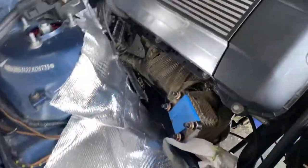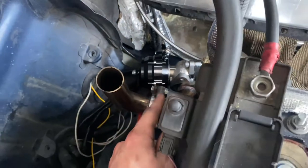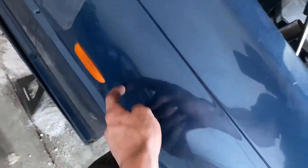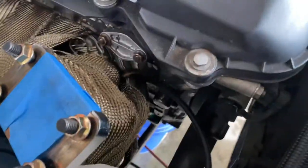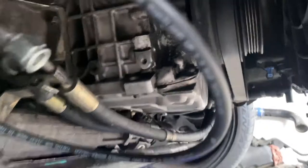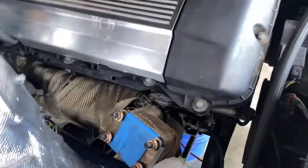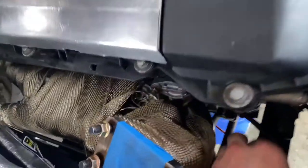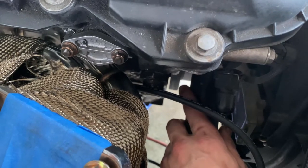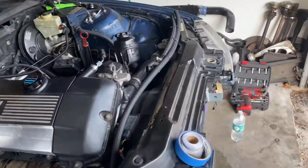The header is re-wrapped and we've got the Precision wastegate bolted up and mocked in place. This pipe is not secure yet but this is essentially how it will be, except we're actually going to side-dump out of the fender. I gotta wait on a new pipe for that side of the engine. For the coolant and oil lines — there's actually a drain right up under here, that's an M14 by 1.5. That is what I'll connect one of the coolant lines to, and I also have a coupler coming in that will fit a dash-six AN line to drain coolant back into the line.